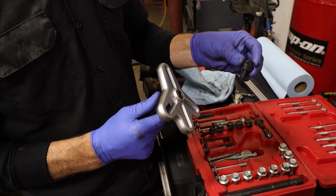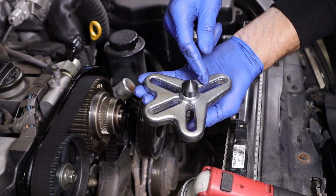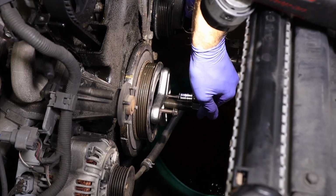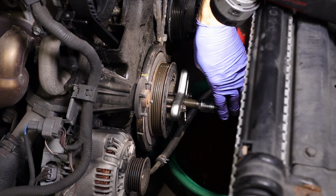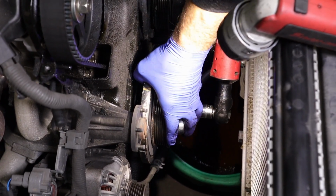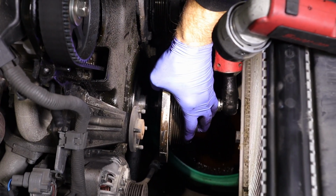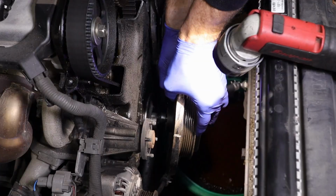And then I'm going to put it so that the flat spot is away from the pulley. Then I'm going to use a little crank center pivot. So see how we got straight across? We're only 2, and then we use 3. So we're going to go straight across. You can snug them down a little bit. You want them even. It's pretty even. Give it a pull. Grab a hold of it so it doesn't fall. There we go. Whoa, it's slippery. Pull the whole assembly out.